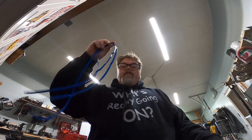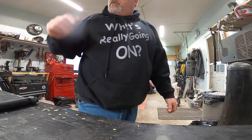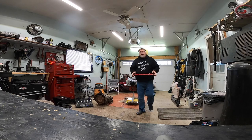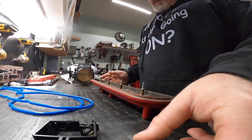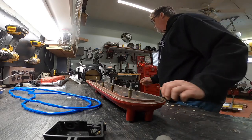Hopefully you agree with me — don't forget to comment below. I've got some new gaskets here for the valve covers so we'll get them off and bring it over here and do a doodad and whatnot, because that's what I do. These are just finger tight and they'll just pop right off. So that's it — I just had them finger tight. This one here has a gasket out already and it's dirty. I've sandblasted it, so I should clean this — I can't put it on like that.